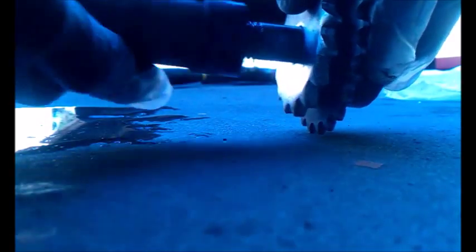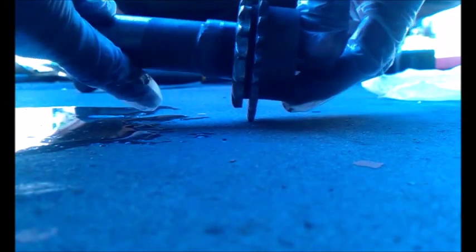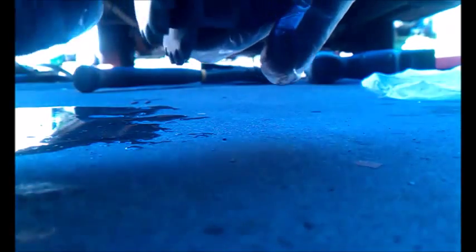So you see, this will slide on, has that nut on it that will hold it on, screws on, and as it screws on it tightens against the cog, which will hold the brake pad and keep the roof up. When you start loosening it, it lets this cog spin free, lowering the roof. If you get contamination in here on the brake pad, it won't hold, it'll just slip free. And that's the most common. What you also need to do is make sure these are kind of lubed, because this has to go back and forth. And that's it.